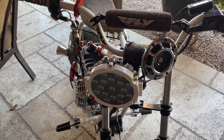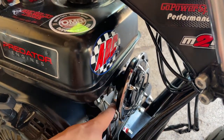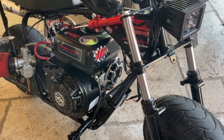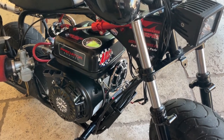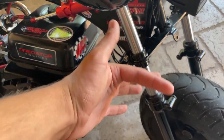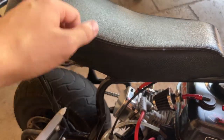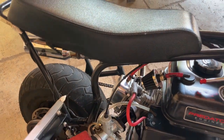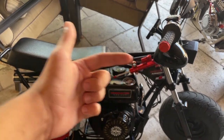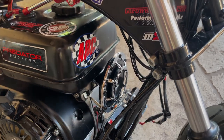That's where my dad mounted his, and this is where I mounted mine — basically just cut the bracket and mounted it on the motor right there. I think it looks really nice and sleek and it's kind of under there. But keep in mind when you're doing this, make sure it's forward facing and somewhat out, because if you mount it underneath the seat facing down or to the side, the noise is going to go that way. You want it going forward because that's where the bike is traveling.